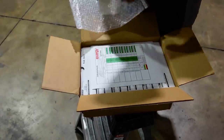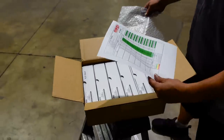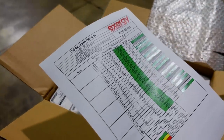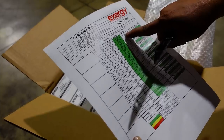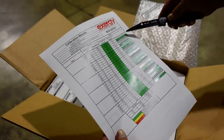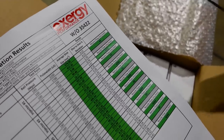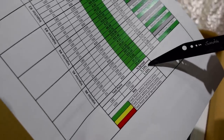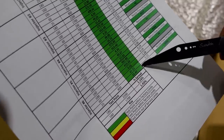These are the 300 percent overs. You can see the flow sheet — they are ready to roll: 574 milligrams at 2,200 microseconds, 180 MPa. This is your shot-to-shot deviation, so they take a thousand shots of the injector and measure the percentage of deviation at running. This is the return flow of the body and the nozzle flow when it's not on the body. Overall, all six injectors have a 1.1 percent spread of flow rate all the way through.